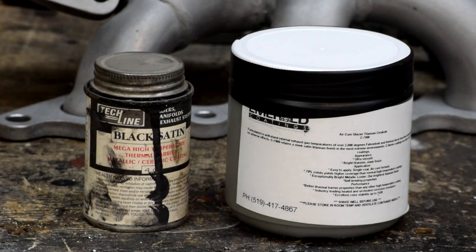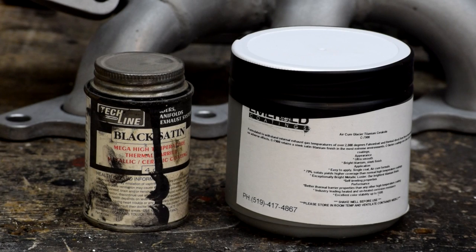I've been talking about ceramic coatings and this is the stuff I'm talking about. A ceramic coating is a sprayed-on coating, sort of like a paint, that has a ceramic substrate to it. When it cures — and there are a couple of different chemistries you can use to cure — it forms a layer like an epoxy with ceramic particles embedded into it. The first property is usually a degree of corrosion resistance. The second is that it will withstand high temperatures so it doesn't burn off like typical paint. The third property is that it acts as a thermal barrier, preventing a degree of the heat inside the exhaust from radiating out into the engine compartment — like a heat shield or heat wrap but as a sprayed-on coating.